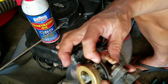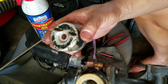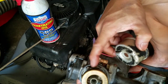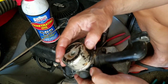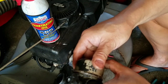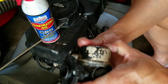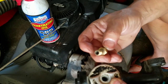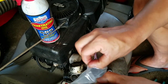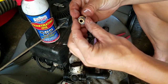All right, nice thick gasket there. Because of the pivot right here, right? There's a droop in this bowl. This line here, line it up with that. Can't just go like that anywhere. It has to be like this. Okay? That doesn't seem like it's... See how that is? It's too easy to move around. I think that'll leak. Oh, I'll try it. I need to find a gasket for this one. Man, so many things to do. Maybe this one will fit. It does.